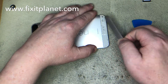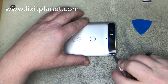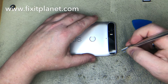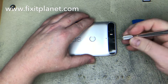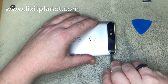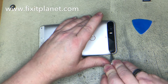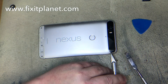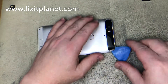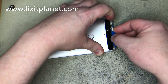The bottom side is not too terribly bad — it's still really tightly fit so it is very difficult to get a gap started. But the top part is even worse because the plastic could crack on you or chip. Some people are saying it's glass; I don't think it's glass, it's actually a hard plastic, but in any case it could chip or crack. I found right near this little spot next to the band on the top I was able to get that tool in there just enough, but the metal tool is still too thick, so we had to switch over to the pick, which is a very thin one, and it slipped right in.